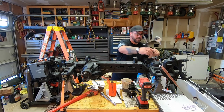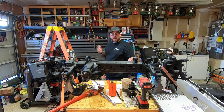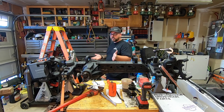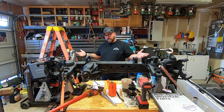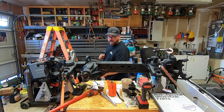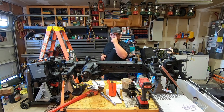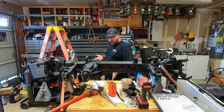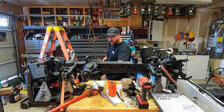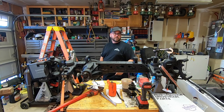Let's take this off and we will run a pattern. I don't know how confident I feel reading the pattern — there's a lot of instructions in the book, a lot of different pictures, and a lot of different videos out there. Just don't take my video for it because I'm just some guy in his garage. I do know that we want to apply pressure on the ring gear when we're running it and we want to run it rather quickly, so I'm going to use my impact — it's not actually impacting, it's just going to spin. I need to apply pressure to my ring gear to add resistance, mimicking tires on the ground, and we will run our pattern. We're going to paint both sides of our gear here on a few teeth.